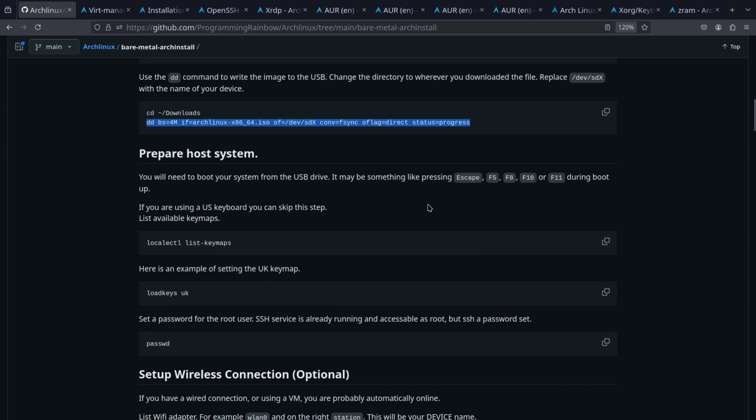Okay, so what I'm going to do is stick in this USB device. We already have the Chromebook running, but it was running with the system already on it. So I'm going to stick in the USB device, and for me the key is escape. I'm going to press escape when I reboot it so I can boot off of the actual USB. I can't show that on camera, but that's what I'm doing.